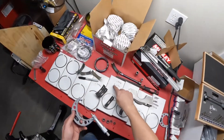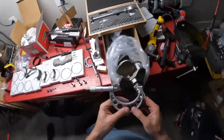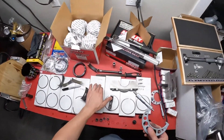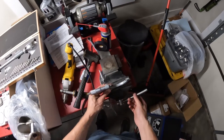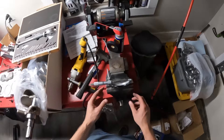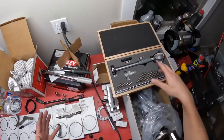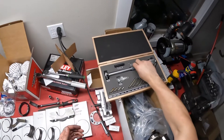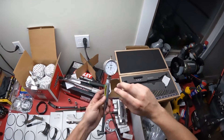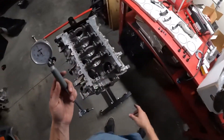The measurement for this one is 2.646 inches. We're not really concerned about exactly what the measurement is — we're more concerned about what the clearance is going to be. The way we do this is very lightly put it in a vise, and we have our bore gauge. We're just looking for a difference, because the difference is going to be the space between this main journal and the bearings.